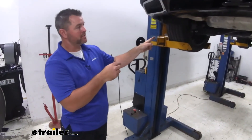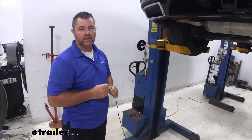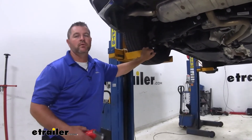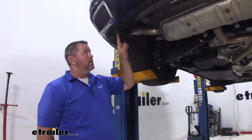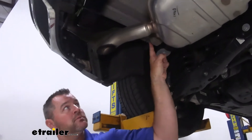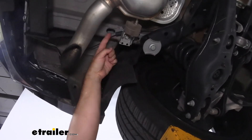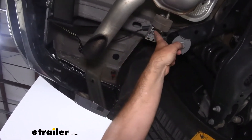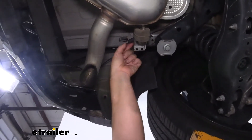Now we need to get our power wire up to the front of the vehicle into the engine compartment to the positive side of our battery. To run our wire up to the front of the vehicle, we need to make sure we're staying away from anything hot or moving. The best way to do it is to try to find some factory wiring attached to the vehicle. In the back, where our exhaust mounts up to the frame rail, I ran it through that bracket. I put a little piece of vacuum line — just split it and wrapped it around there — as a buffer for the wire so it doesn't rub on the bolt.